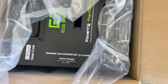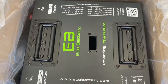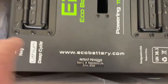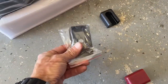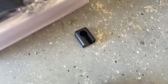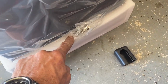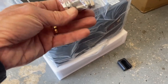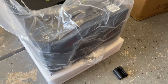This is definitely going to be a two-handed job. One thing I want you to note when you unpack this battery — maybe you're doing this for your customers — go ahead and write down the serial number because they're going to need it when they register it online. That's your hold-down bracket — a little spacer washer that goes right on top. These two covers are what cover your positive and negative posts, and there are your studs for the battery. They're kind of hidden on the side of the styrofoam, so if you're not careful you could easily throw them away.